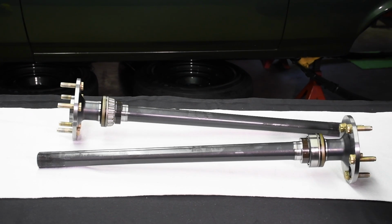With the kind of loads an axle sees in a hot rod, there's more to it than just simply the tensile strength of the material. The ductility of the axle shaft plays an important role. The load presented to the axle is so large that it must be able to twist and rebound like a torsion bar instead of being too stiff and ultimately snapping.